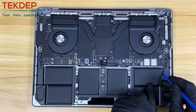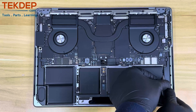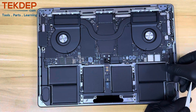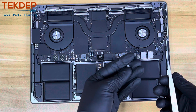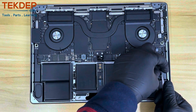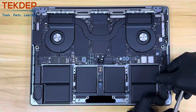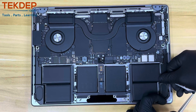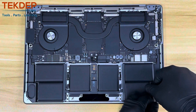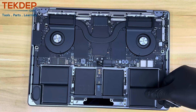In order to remove the battery, first we need to pull the eight adhesive tabs from the edges of the battery. Using your pry tool, dig for the tabs and then pull them out slowly. In my experience, this was not smooth as they all break halfway, leading me to dig back again for the same tabs. This was a little frustrating, but with patience you should be fine. This was Apple's final effort to make battery replacement easier, but not sure if they succeeded — why not just secure the battery with screws like every other brand? Maybe you can tell me why in the comments.